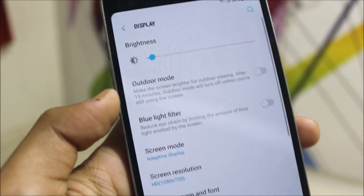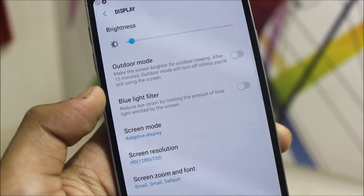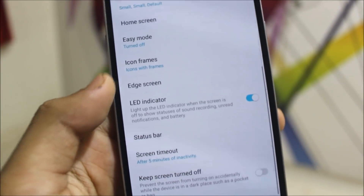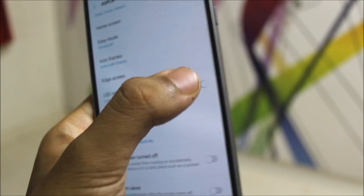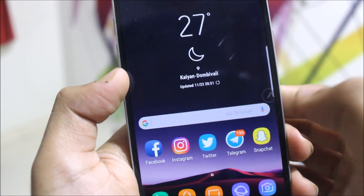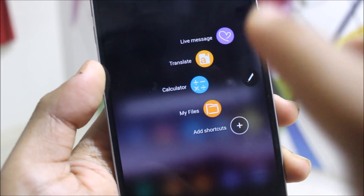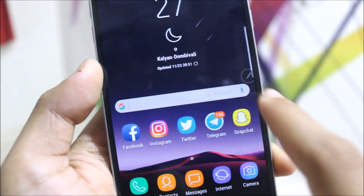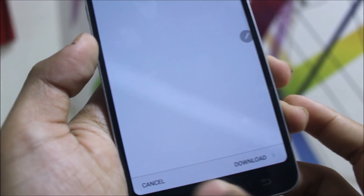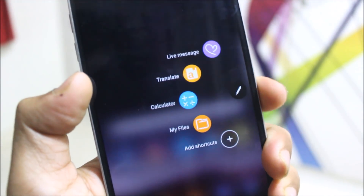After doing that, the display will look correct. When you install this ROM and do a fresh reboot, you'll see blurred things on screen — just do that resolution fix and the screen becomes fine. There's an LED indicator option but it won't work since the J7 2016 doesn't have one. Since this is a Note FE port, it includes Air Command, which looks really awesome with the blur effect. You can see Live Messages, Translate — for translate you need to install the Optical Reader app.